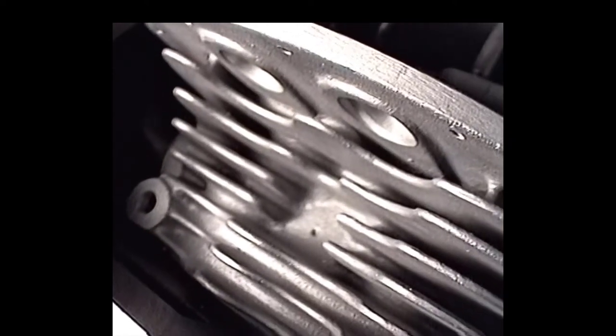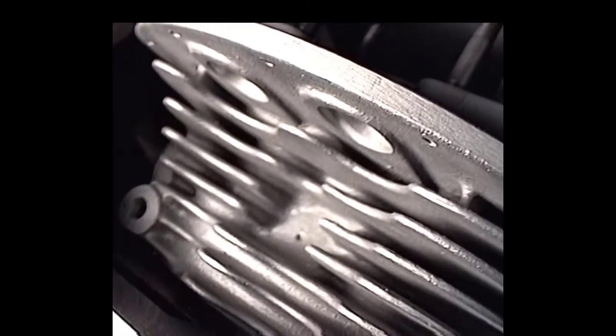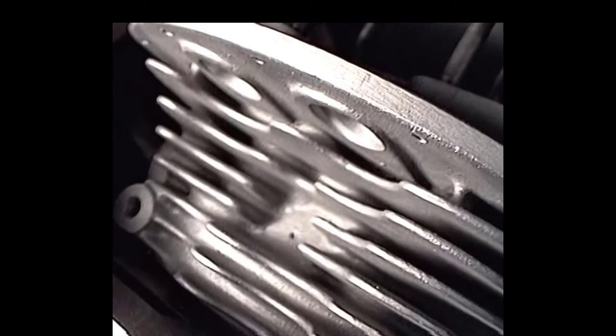You've got to have a pretty extreme angle because you have to be able to clear the top part of the head, where the push rods go through and the pan covers ride. You've got to be able to get your spark plug and your spark plug socket in. Plus, you have to have clearance for your cutter. I had to modify this cutter that's in the machine right now. I had to turn the shank down. This was a number 2 Morse taper, and I turned that shank down to 9/16, which is as big as I could be and still clear the head. So anyway, we're going to try and indicate this thing in now.